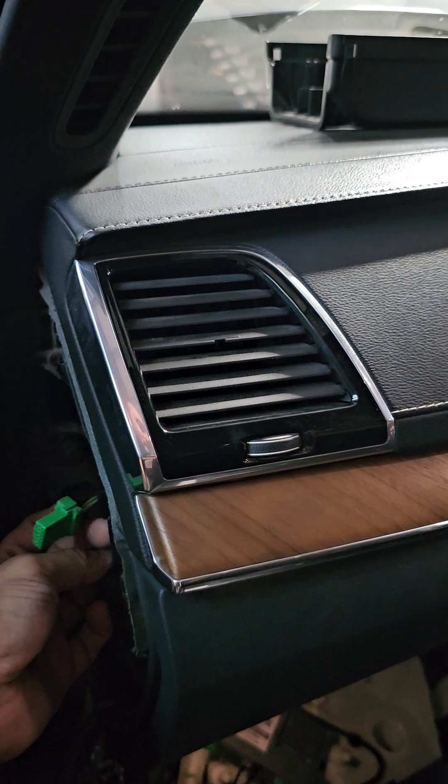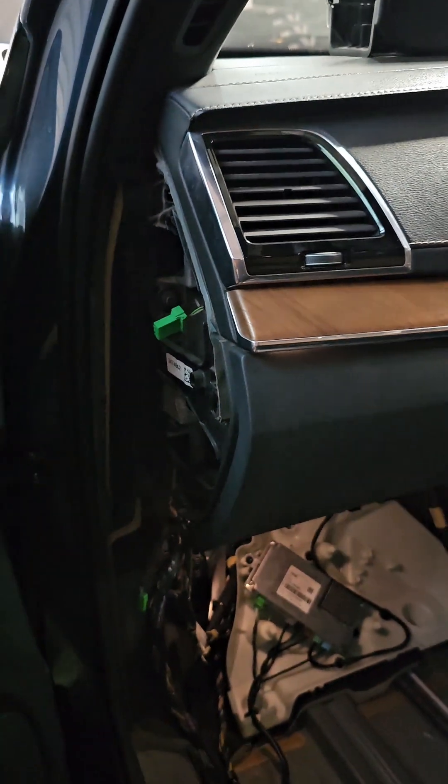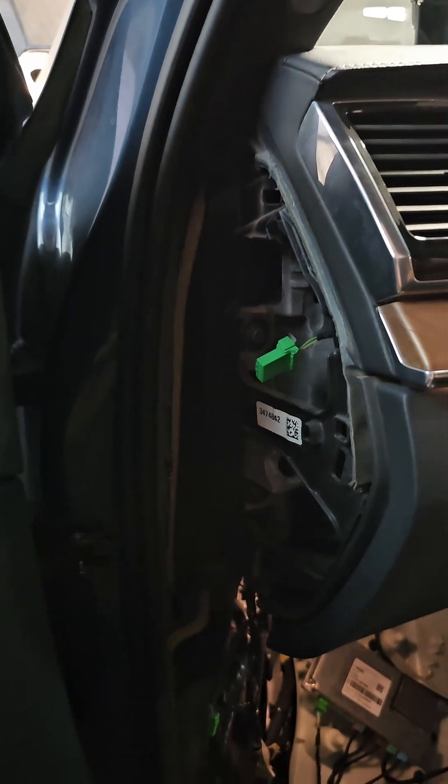Once you remove it you get an airbag fault. It's basically going to tell the controller that the co-passenger airbag is switched off. So in case you are having faults for the co-passenger airbag, maybe the workshop where it went did not plug it back in.